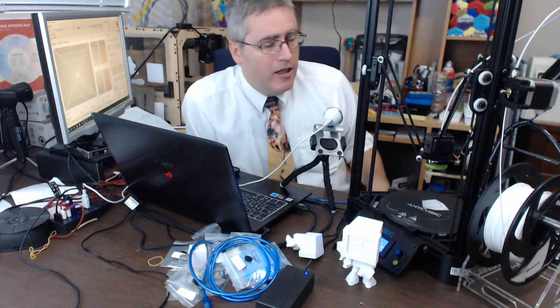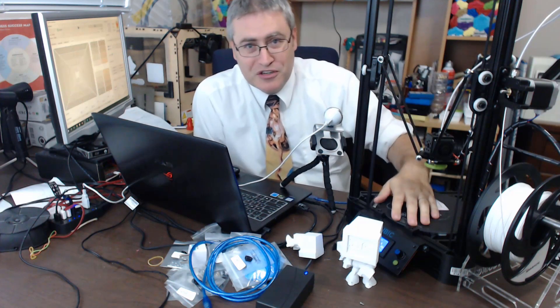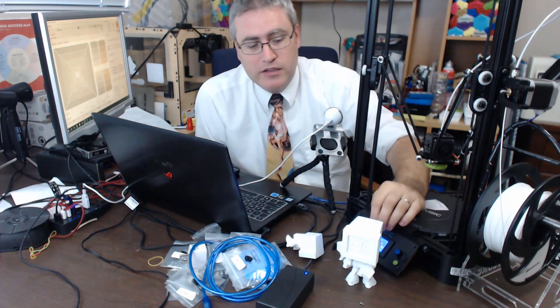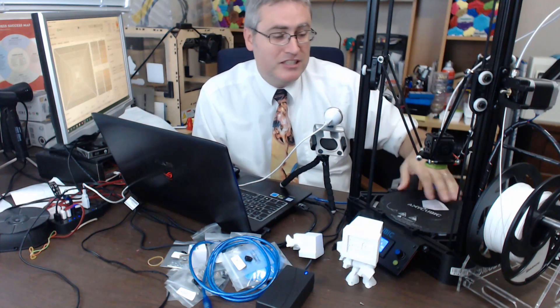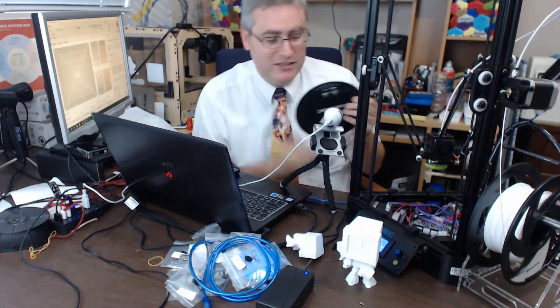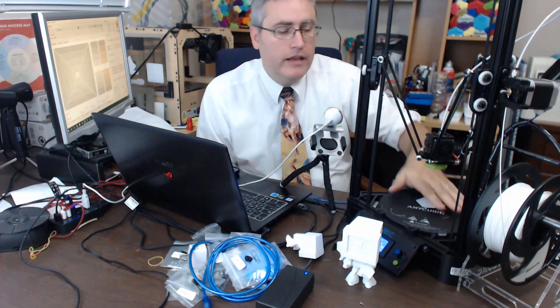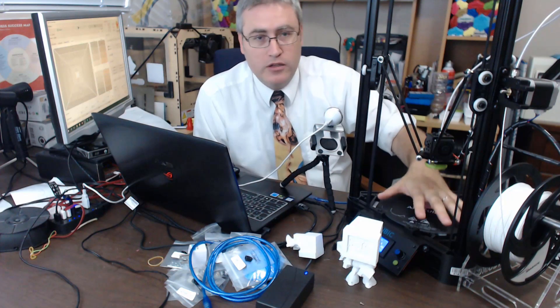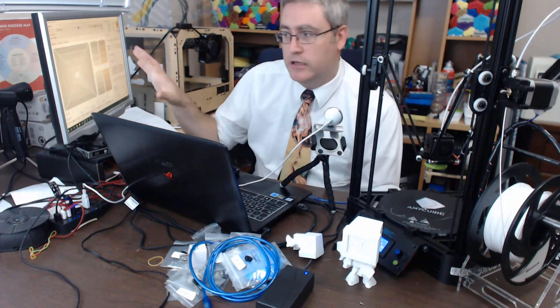So far, in order to load filament, you heat up the nozzle through the menu — but it immediately fails out. I think it fails because when you heat the nozzle it also tries to heat the build plate, but this is not a heated build plate — it's just a piece of glass. So it fails because there's no build plate to heat. I am going to get the heated build plate upgrade, but this is a bug in the firmware.